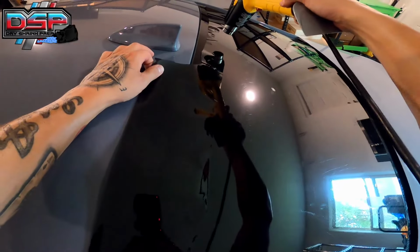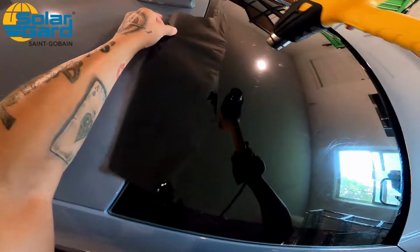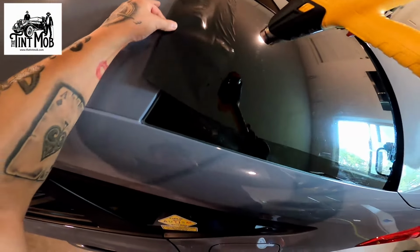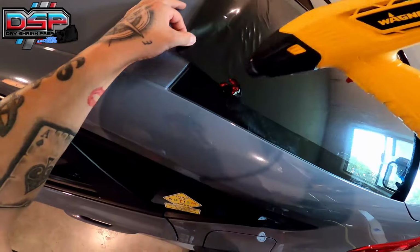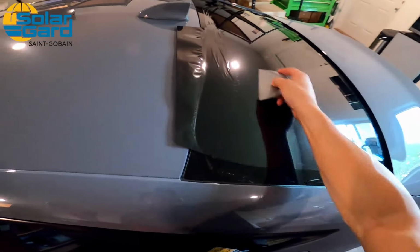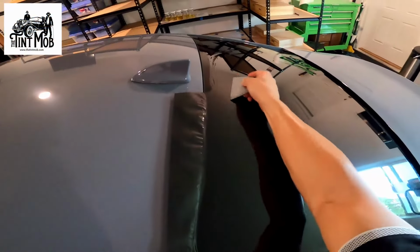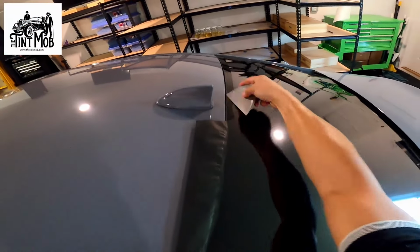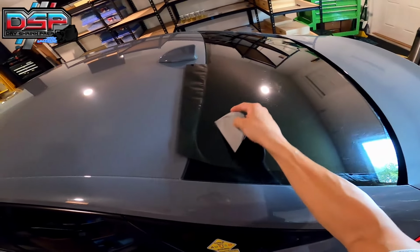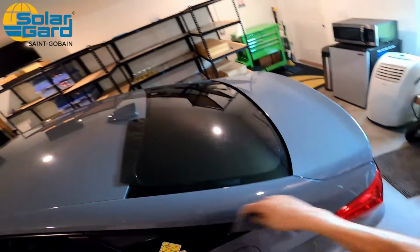We're not going to just shrink to the line. We're going to shrink all the way up to the top. Okay, if you need to, use that handle and pull. Okay, and we're going to go all the way up past the line. Okay, we want to shrink. I can see it because this is a pre-cut piece of film. The line's right here, so I've shrunk way up here. If I wasn't using a pre-cut piece of film and I was just going to shrink, I know that the film roughly stops here. I mean, the ceramic coating roughly stops around here. So I want to shrink just a little bit further. So when I hand cut, I know I'm already laid down.